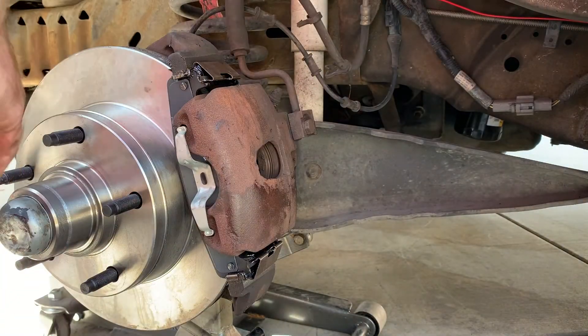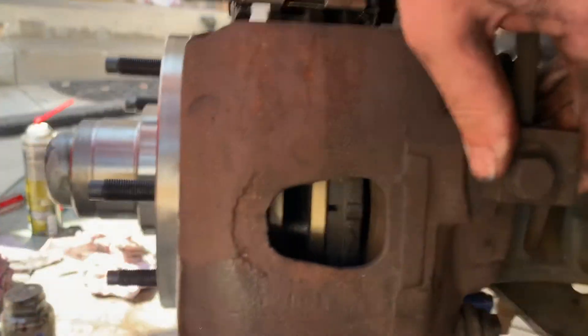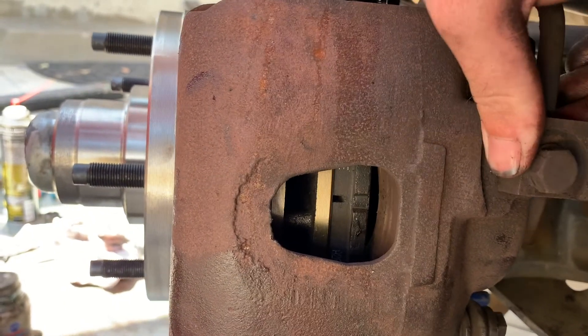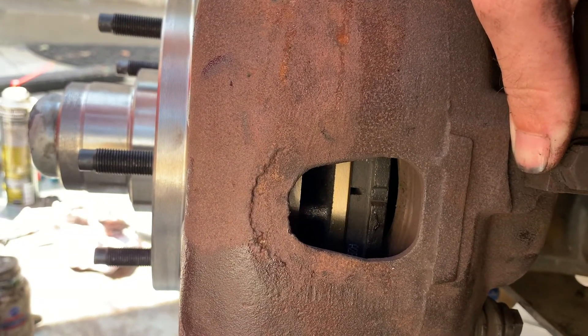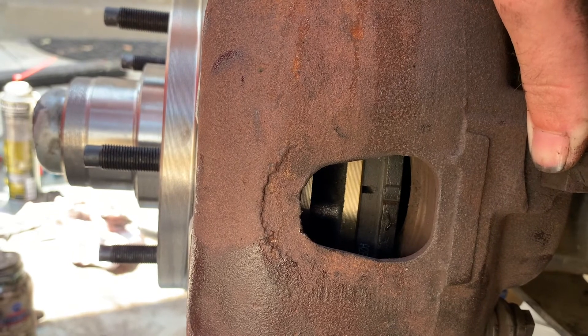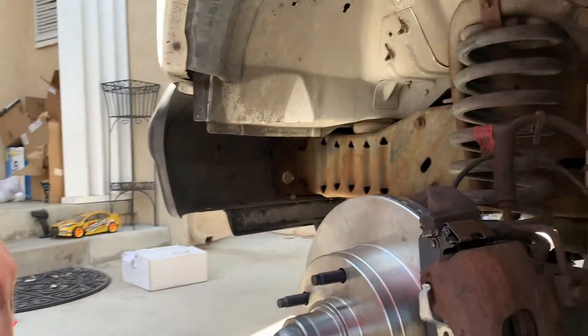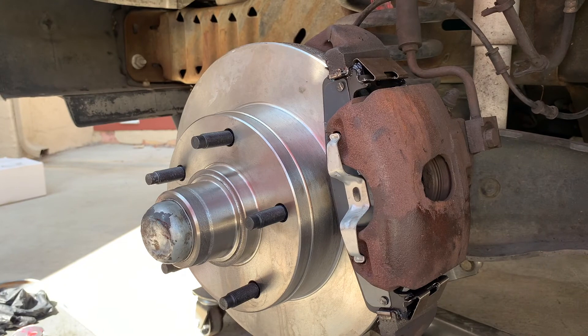If the caliper slightly feels loose, it's because we don't have the piston compressed all the way up against the pads yet — you can see the tiny gap. When we go to start the vehicle, we're going to pump the brake pedal until we feel pressure, then start the vehicle, and we'll know for sure we have the piston all the way up against the brakes and we'll have brakes to drive away. Don't forget to put your master cylinder cap back on. That's as simple as it is to do your wheel bearing — if you even had to replace your wheel bearing, you've seen how to put that in and out. We covered replacing the rotor and replacing the brake pads. Have a great day, thanks for watching.